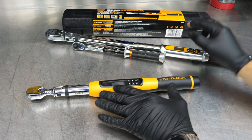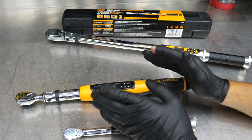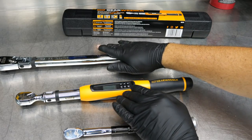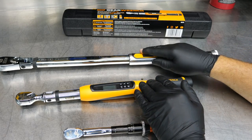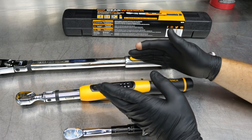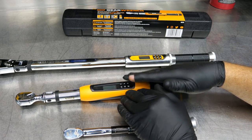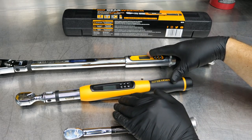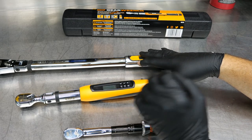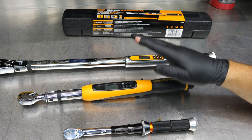That's why I bring up the point of having multiple torque wrenches. This is 10 to 100. If we really only want to be in the 20 to 100 range — and by the way, the upper limit is absolutely fine — it's just like this larger torque wrench, which is rated from 25 to 250 foot-pounds. We really don't want to be in that 25 to 50 range with the big torque wrench. So that overlap is where you want the smaller torque wrench. And that's easily going to come into play on any of these newer engines with torque-to-yield fasteners. That's also why it's important to have an angle measurement on your torque wrench.